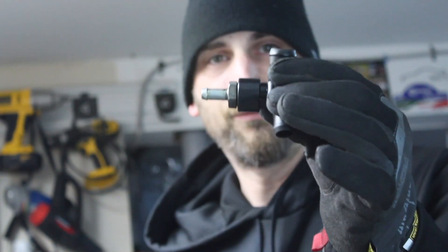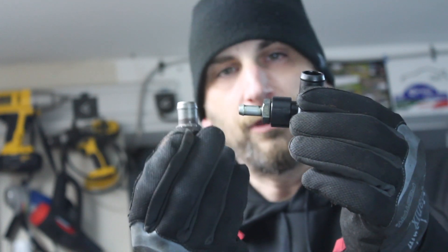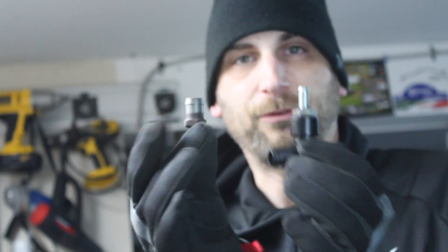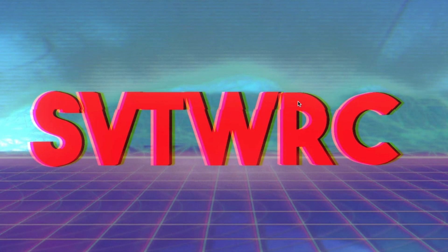Hopefully this helped everyone differentiate between the WRX and the STI — the 04 STI and the 02-03 WRX. Someone said they're the same, but they are definitely different. This one's under the intake manifold; this one branches out from the crankcase vent side. This one's under the crankcase.